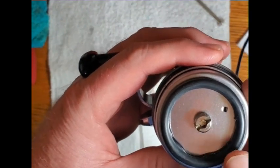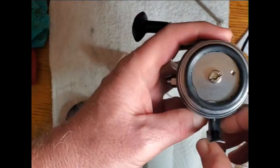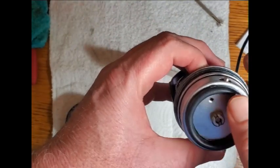I've chosen a contact adhesive that's supposed to remain relatively pliable but also hold the o-ring firmly. I'll put some adhesive on the ring and then center that ring as best I can onto the spinner head. I'm going to leave that set upright until it's completely cured — I'll let it set overnight — and then we should be finished with the service and repair.